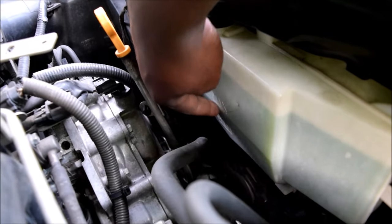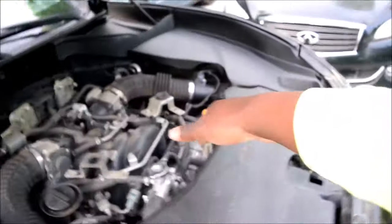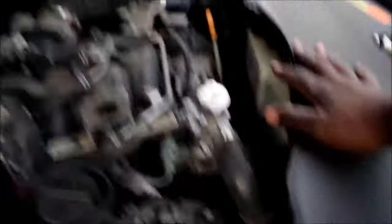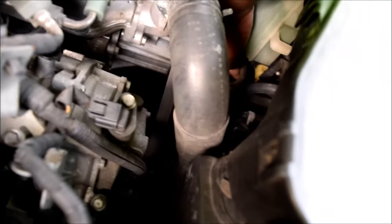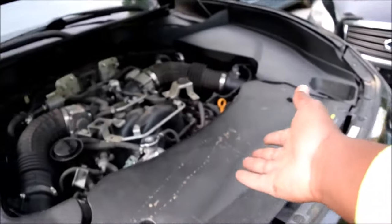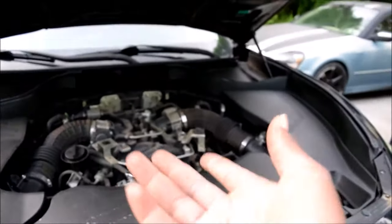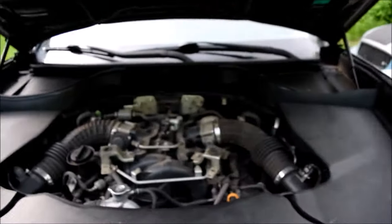This is the max level, this is the minimum level, and ideally you want your coolant to sit somewhere between the two marks. Mine is really high, and I'm glad I'm watching it, because if I weren't, it's very possible the coolant will rise so high it ends up dumping through the overflow tube down here. I'm going to go ahead and turn off the car so we can talk clearly and explain some of the key components and why everything is important.